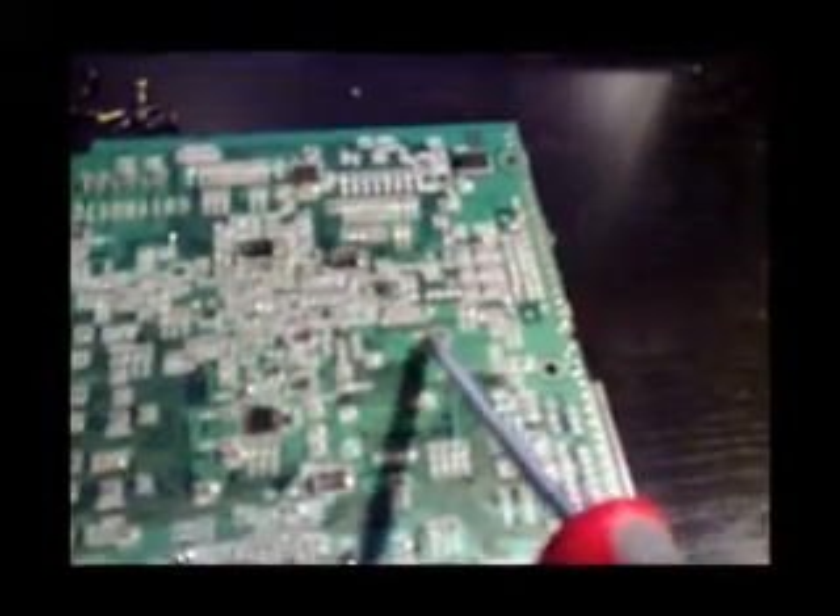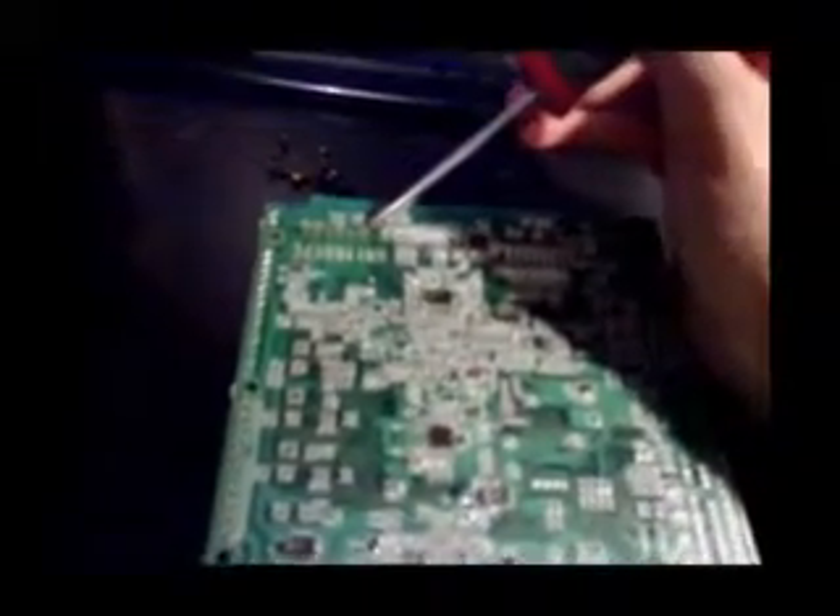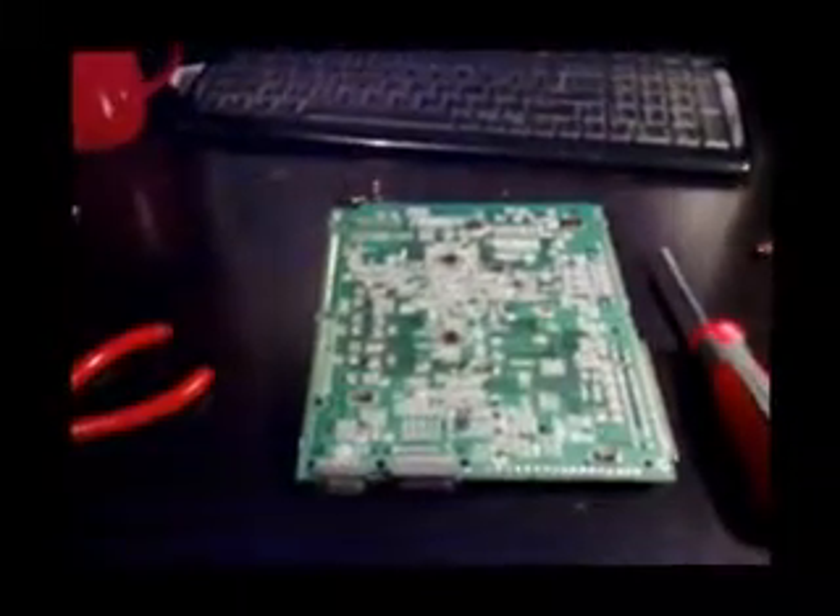Resistor 512 is down here — the camera is hopeless, so I'll upload some high-quality photos. You've got plus 12-volt up here, so you just need a wire between those two points and you're good to go. I've got a little switch, and I'm going to solder to the outside leg and the middle leg so this mod is either on or off. That way I don't have any accidental rewriting, because some games can rewrite to internal memory and damage the original data on there.